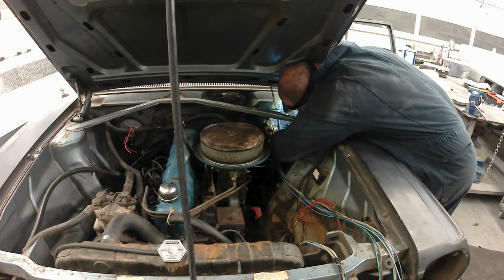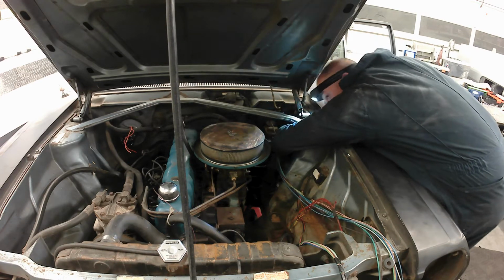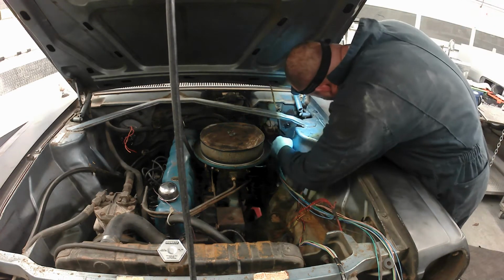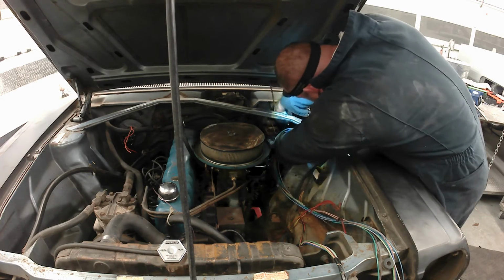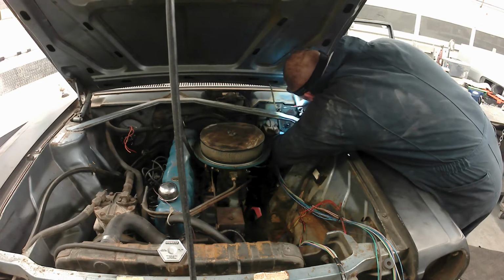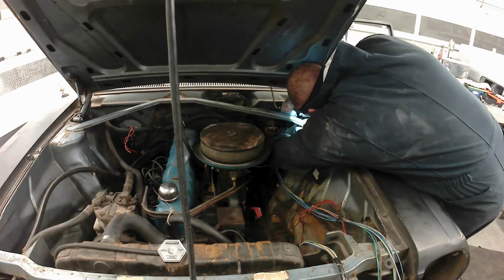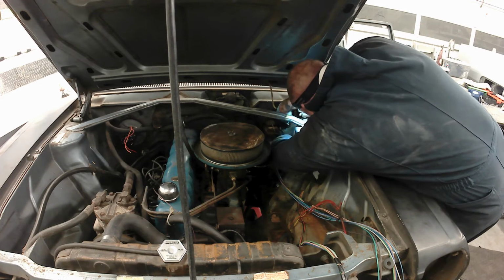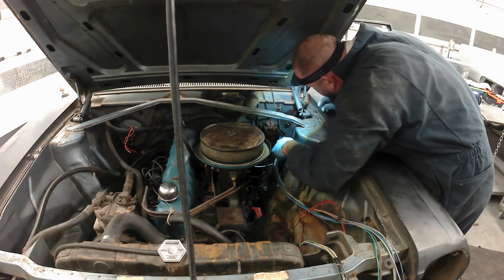That way, like I said earlier, leave some tails on there, some 6-inch tails if you got a crazy alternator, generator with remote this and that. Sometimes it's helpful, and then obviously if there's some aftermarket stuff in there. Like this one's got some crazy air conditioning system that is old and doesn't really work well, but it is helpful to kind of have that stuff on there. It's outside the scope of the normal circuit diagram on the Kwik Wire and on the original stock diagram, so keep that in mind. I think it's a really good tip, and that way you still got a piece of wire there and you kind of think back how it went.